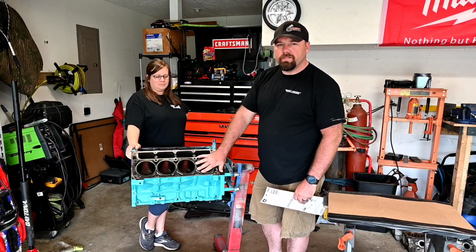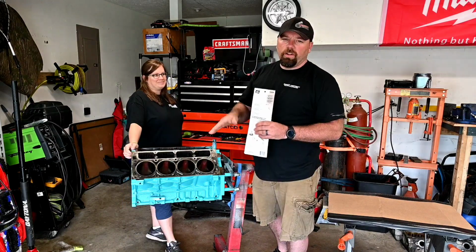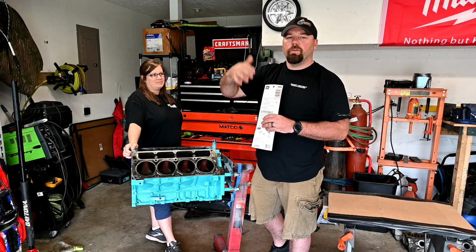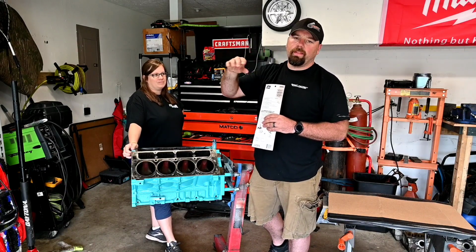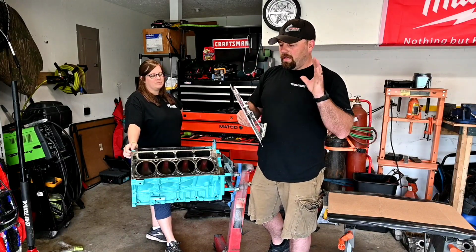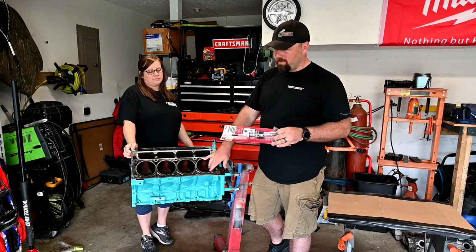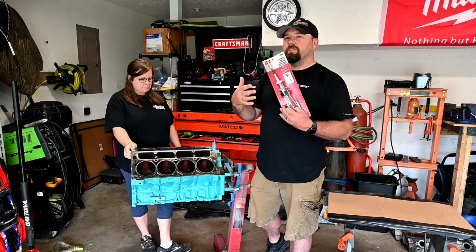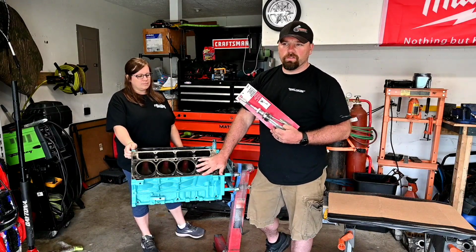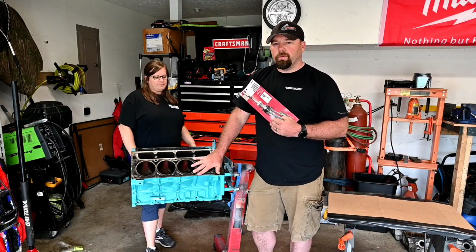Down inside, I think I may have seen in the video earlier, a little time lapse there. If you look down inside the cylinders, you'll be able to see where the rings are raking up and down, scraping the oil, doing their job. But at the bottom of that is just fired oil. It's hardened up, and we're going to break that stuff off and get that cleaned up and put some cross hatching back into the cylinder walls. Not really trying to remove any material. Just get them cleaned up so that they can hold a little oil. So this engine will last a couple years, is probably what we're looking for.